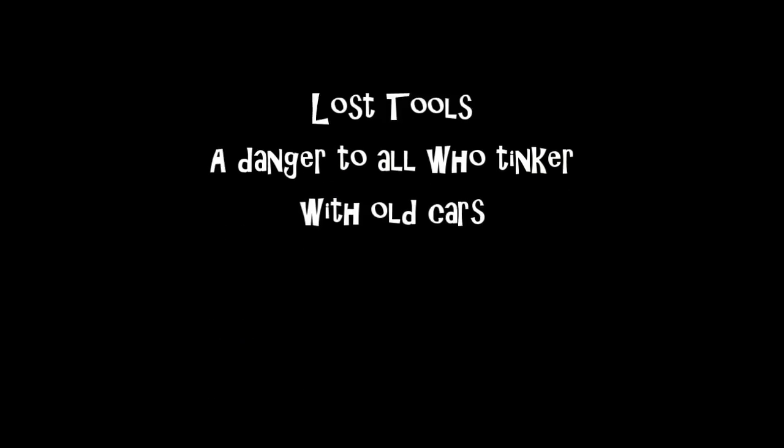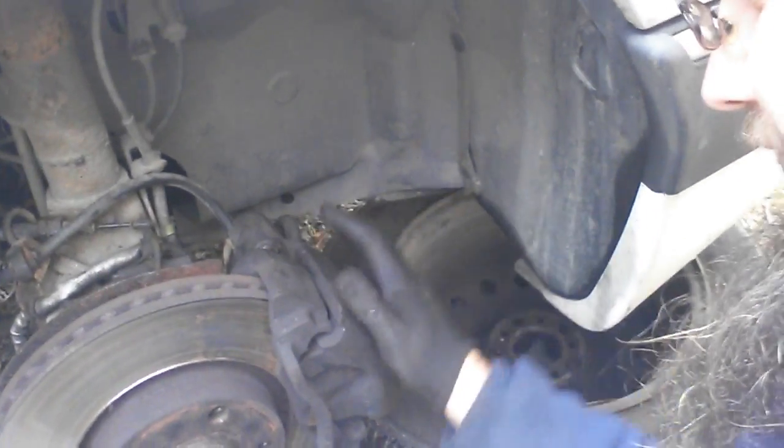I got the carrier off, but I did have to borrow a spanner — I've lost mine. So what we're actually aiming to do today is replace this slider. It lives on the caliper right here at the top, and that's what this caliper slides back and forth on. The problem is the boots have got torn over the ages and aren't protecting the slider. So I've got new boots to go into the caliper as well, so that should keep this new slider from corroding.